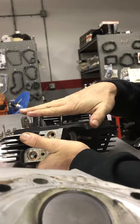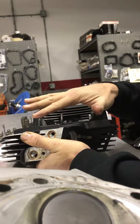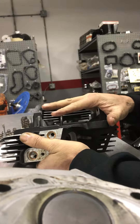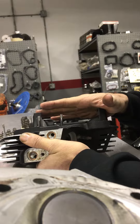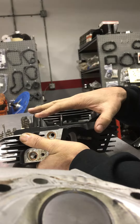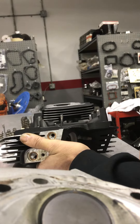If you have a little air gap with one valve being longer or one valve being shorter, A, it's going to tick, and B, you're not going to get full valve lift from that side of that cylinder. There are a few tricky things we're learning with the setup on these four-valve heads.